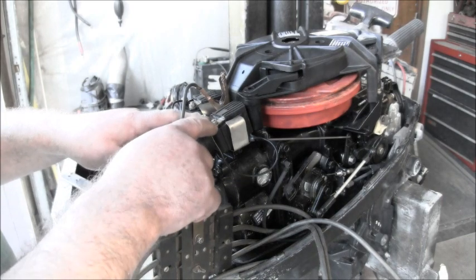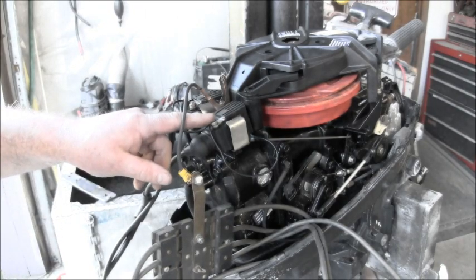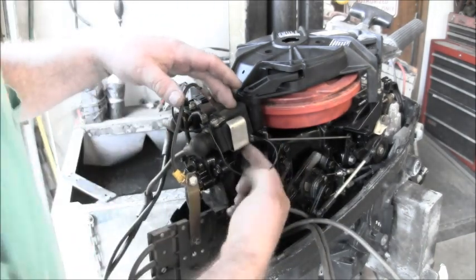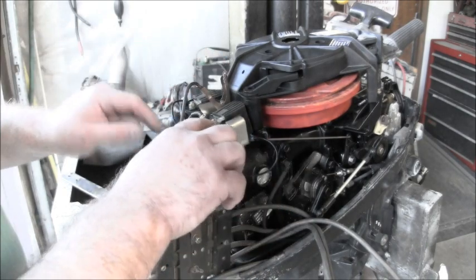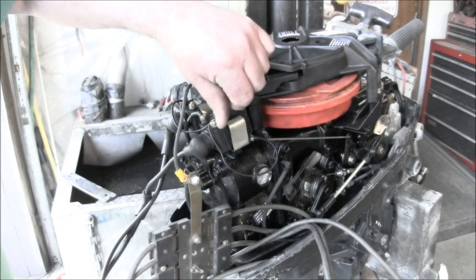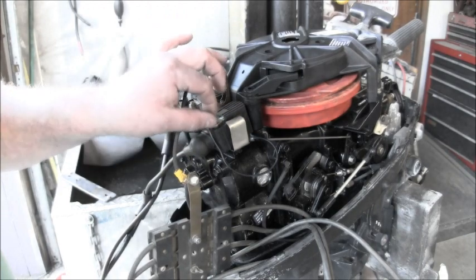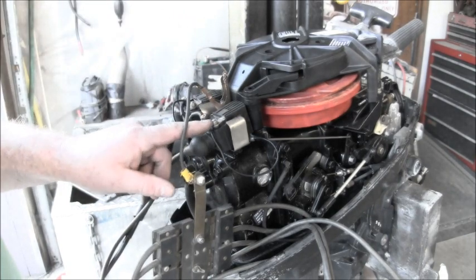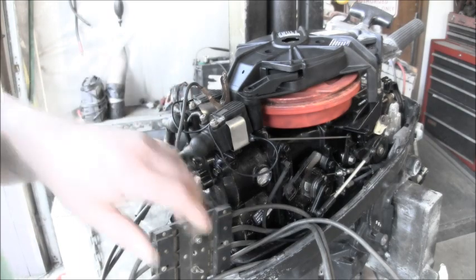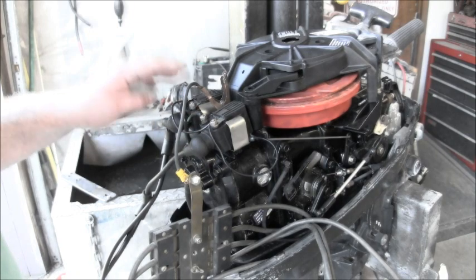Now one thing that he did on his other ones, they grounded through the bolt, the screw that went through up in here, I think, to the block. And that grounded. And now what he did was he put a ground wire under there, came around and grounded it to the ground. You can see there's a ground strap right here that comes to your ground. Okay, so I would have done this differently. I would have put actual little wire clip eyes and stuff. Well, then he ran this ground right on over to this ground, which again, that should be fine. Grounded to the block, grounded to the strap, grounded to the strap. That should work. And then it's two hots.